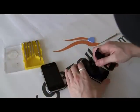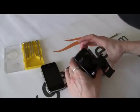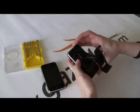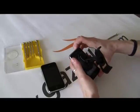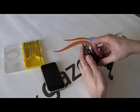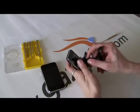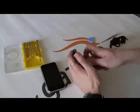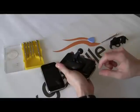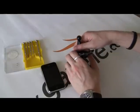Here's the secret — you just stick that in. You want to make sure the phone's off actually. Let me just turn it off real quick. Put that back on again. And we just want to give this a good pull from this side, from where the home key is, to the back. And it should pop off.